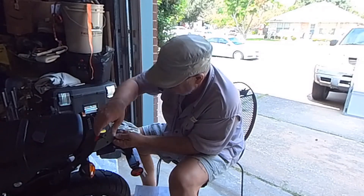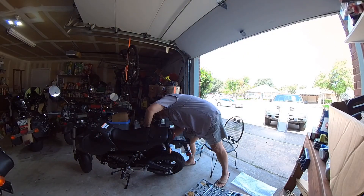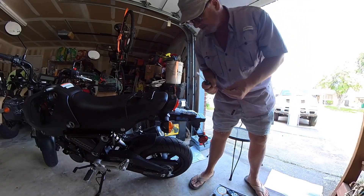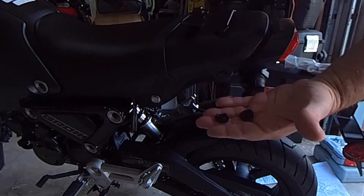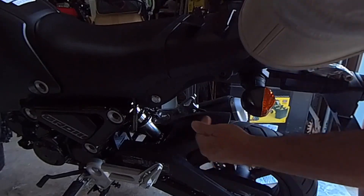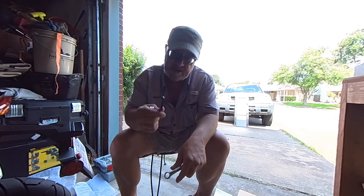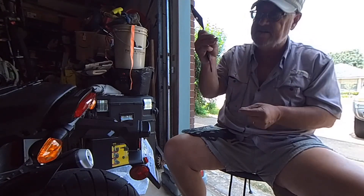The rack is supposed to go on just like this — the bracket goes on the inside and bolts to the tapped holes on both sides. I'll put the bracket together and bring you back. I know my camera skills leave a lot to be desired. Basically I'm taking off this cap and that cap right there. They just pop off with a screwdriver or with your fingers. These are threaded in here so you're going to need a 13-millimeter box end wrench and a 6-millimeter Allen key.